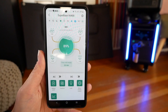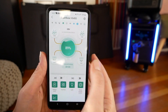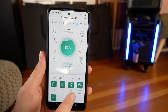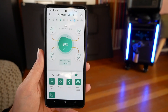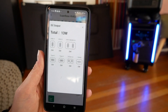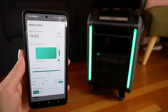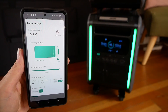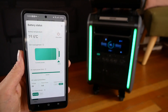The battery overview screen shows how much you're currently charging or discharging through your DC or AC ports. You can tap the DC output port to see the various ports and the total wattage they're drawing — in our test it only showed the overview, not which specific port was drawing how much energy. From the battery status screen you can see battery temperature, remotely shut down the entire unit, set a maximum charging level, control the AC input power limit, and switch the AC output mode from RV mode to 240 volt, as well as switch between 50 and 60 hertz.